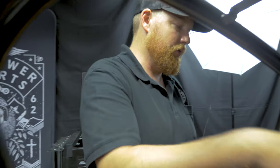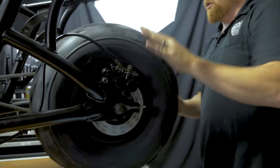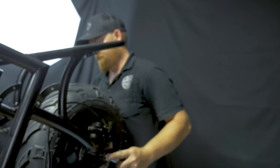It's probably gonna be different on your bike. Everyone's gonna be different. But that's about the tension we're looking for with a new chain. Got about 3/8, maybe half inch play either way. But the main thing is that you're on the same line on both sides. That's gonna give you a true running chain. After those are set, come back and do your final tightening on the axle.